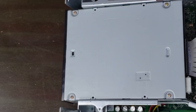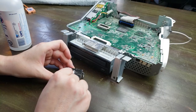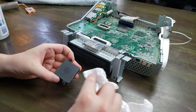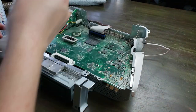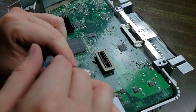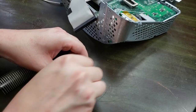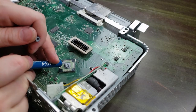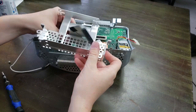Time to isopropyl the thermal paste. The thermal paste on this machine was rock hard — it had basically turned into a plastic product. I'm surprised I was able to clean it off. The bottom of the heat sink had it real bad, building little trenches inside everything. We managed to clean that off. The real pièce de résistance is that heat pipe with the fins — you should see the thermal paste on that, and you will. So a nice dab of fresh thermal paste for the GPU, chuck that clean heat sink back on. A little dab on the CPU — and wait, we forgot to clean the heat sink. Oddly enough, 99% isopropyl alcohol can convert this plastic back into a liquid that you can wipe off with a paper towel. Look how clean it is — that is satisfying. I wasn't confident with how much thermal paste I put on the CPU after cleaning the heat sink, so it's almost a good thing I did it in that order. Some people may disagree with how much I put on there — I know that's a hot point online.